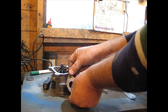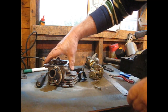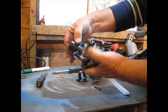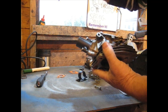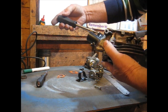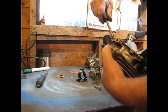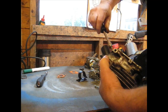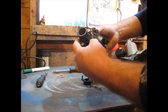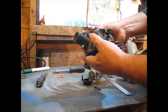My battery ran out so I've just changed it on my camera. What I've done now is put that sealant gasket on there and mounted the tube with these two screws here. Tighten that up equally so you're not tightening one side more than the other. I'm confident that is a good tight seal — there's nowhere air can be drawn in around that surface.